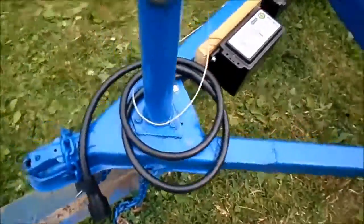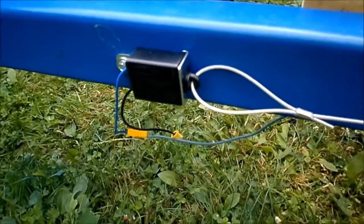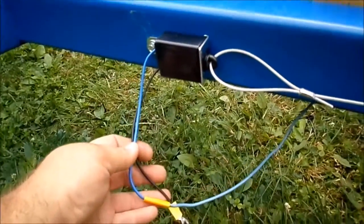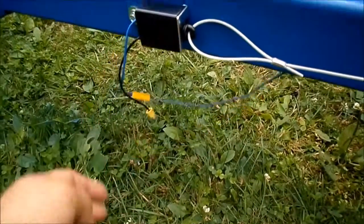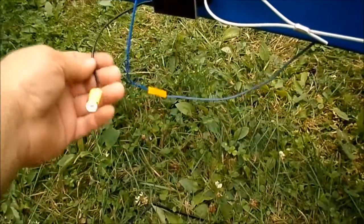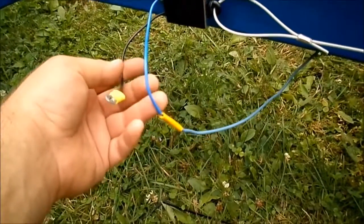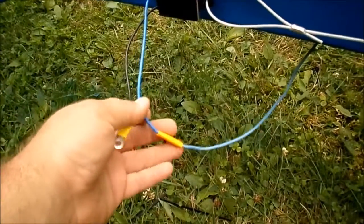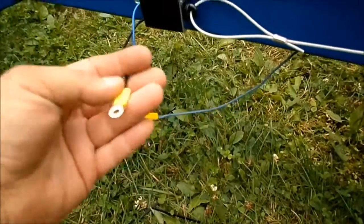On this side is the breakaway switch. It is not 100% hooked up because I misread the wires. Common convention says the blue wire goes to the blue wire and the black goes to the trailer junction box — apparently on this one it's the opposite way. I'll have to make that correction, but I need to get more butt connectors and another ring terminal.